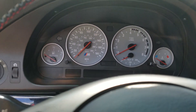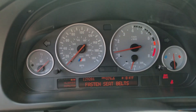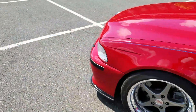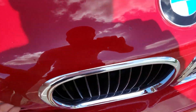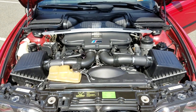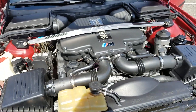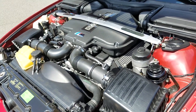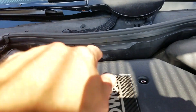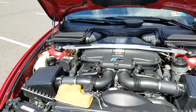I'll go ahead and start it up here. Already warmed up so nothing too crazy. I'll show you the engine bay - at the moment it could use a full detail if I'm honest, but it'll do for now. You can see the yellow expansion tank, which is on the list to get replaced, but overall it's pretty quiet. I just did the valve cover gaskets about a month and a half ago along with spark plugs and a couple other items, and it's all running very well. I also replaced this firewall cover back here - that was all cracked. The new pieces were $130 each, so if yours are cracked I'd suggest replacing them before they get even more expensive.